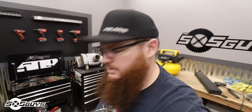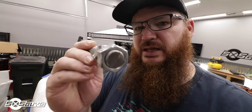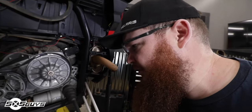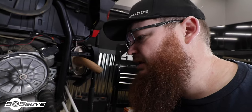New day — was working on pulling the clutch out of Uncle Ben's Razor. Thought it'd be straightforward, but couldn't find a clutch puller tool in time, so tried to make one from a three-quarter-inch 16-thread rod with nuts loctited and jammed on with an impact. But on this 2016 — known for being really stuck and stubborn — the bolt just stopped spinning and the clutch didn't move at all. We blew it out with compressed air but now we're heading to a friend to borrow a proper clutch tool to pop it out.